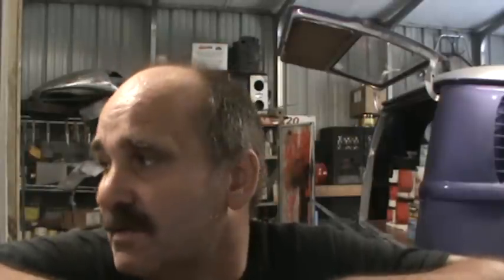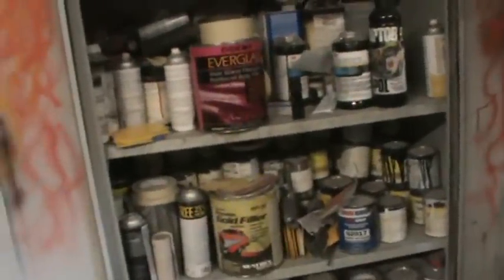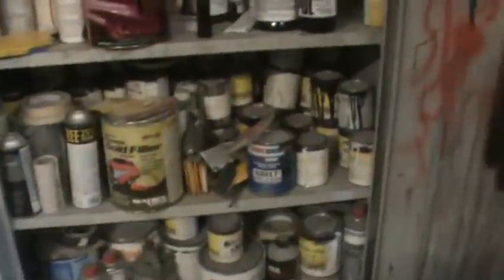And that's why I tried to buy all those different cans of Bondo last time and lay them out on the table. I like the Matrix Bondo, of course, because I can buy it at a really good deal, and it's base coat, clear coat safe. It spreads real nice. It works good for me. It works a lot like the Rage Gold. So for a lot less money, I can use the premium gold filler there, and it spreads better, it sands better, and it's altogether better. I don't care for the cheap Bondo. Not only does it not sand good, it's a false fix. It's gonna let go.